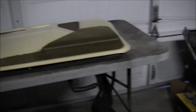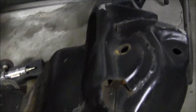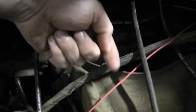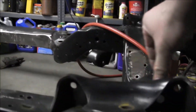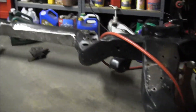One thing I noticed looking at the car: how the heck do the upper control arms mount to this thing? This is the top of the frame — upper control arms go here. I was thinking they just snuck in, not really looking at it. There's actually a bar that runs along the back that gets bolted through. These two bolt holes here — there's a bar along the back, gets bolted through. That's where your tie rod and upper control arms mount to.